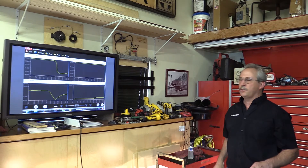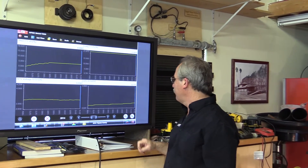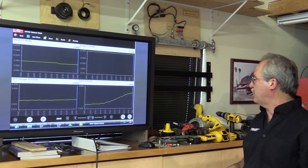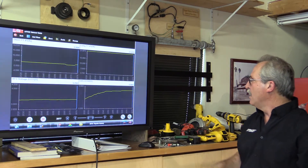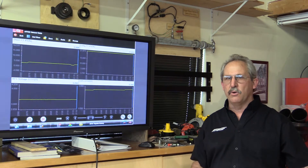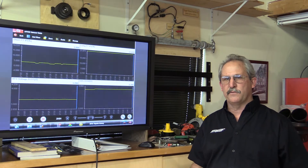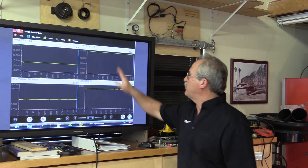That made a change. Now short term fuel trim is down around 5%, though I'm still maxed out on long term. There it goes — now my converter is properly oxidizing, using up all the oxygen, getting back up to 700-plus millivolts. I'm back to about 3.3 volts on the front sensor. So I can do a test here. If this port didn't work, I could pop the air cleaner lid open and feed propane through there instead — I'll show both ways. You don't know until you try.